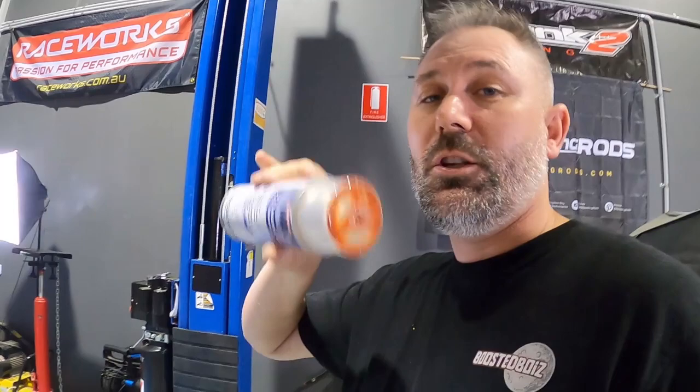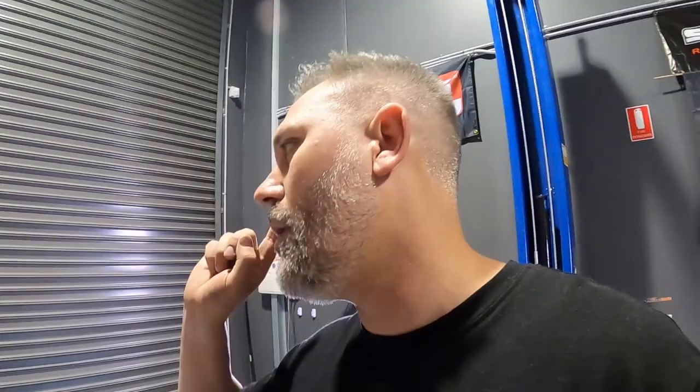For the most part, you then go and take your well shaken can of color. In this case, it's a base coat because we're going to do a two pack or a 2K clear coat on top. So this time we're just doing the color in a base coat, which is a base acrylic. You can go straight to a 2K color coat if you want to, which is what I did on the black car, the black Civic. It was just straight two-pack black, boom, on, dried, done.